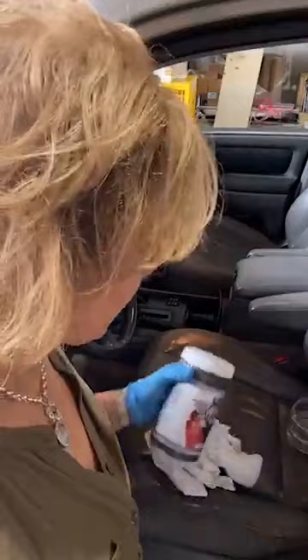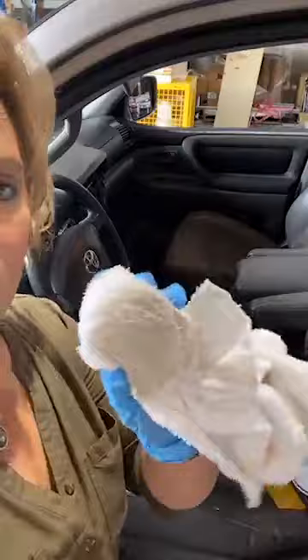I'll be painting tomorrow using the color charcoal — a dark gray — from our RestoreCoat.com line. I've got my gloves on, and I'm going to wipe this down using our prep product, which is our deglosser. You want to get off all the oils and dirt on this seat — all down in the cracks and crevices — to remove any oils, grease, or cleaning products used through the years, many of which contain silicone. We need a good bond with the RestoreCoat.